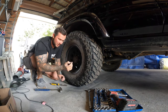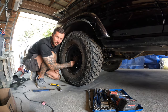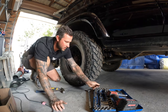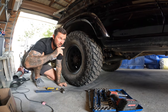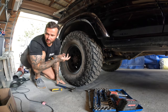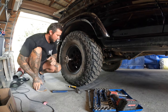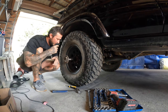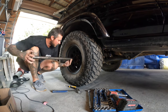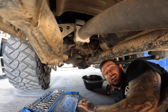Once they start coming they all come pretty easily. Now I'm going to chuck the front wheels, take it out of gear so it's not splined in, I've got my chocks here. That's one axle — that will now be out of the center. I'll go do the same steps on the other side. So we've got the axle out both sides — I'll get this tail shaft off.